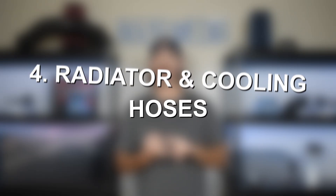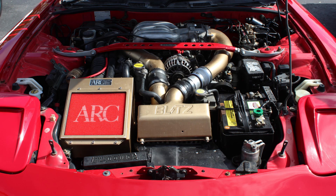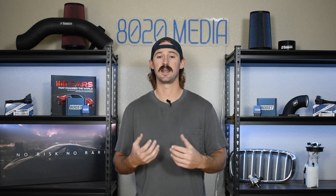In addition to catalytic converter problems, you also have a number of problems with vacuum hoses, radiator and cooling hoses, and the wiring harnesses located within the engine bay. Again, a lot of this stems from the amount of heat that's produced by the turbocharger setup on this engine. Despite the 13B REW being a pretty small 1.3 liter motor, everything inside the RX-7 engine bay is relatively tight. So the heat that the turbochargers produce really gets around to all of the other components in the engine. All of that heat on the vacuum hoses, radiator hoses, and the wiring harnesses can cause them to actually firm up and crack, which will give you vacuum leaks, coolant leaks, and can cause a bunch of electrical issues if your wiring harness fails.